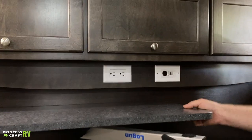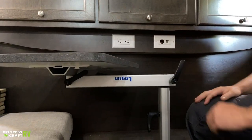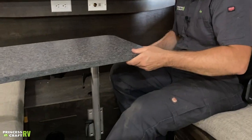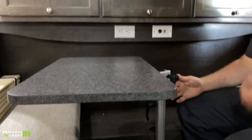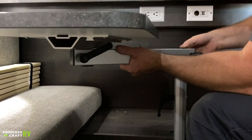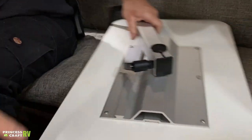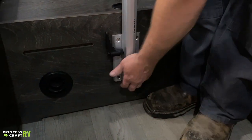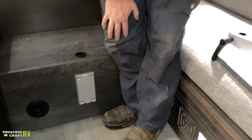We've got your Lagoon table — this thing's pretty cool. It can be moved around and does have all these lock levers to keep things stationary. This table can swing around and be used pretty much anywhere you might want it, and it can also be moved to the outside of the trailer to the mount out there. To get this off, personally I like to take the top of the table off first — just loosen this up and pull up to remove the table top. Then to get your post off, loosen the very bottom one — you can see this is also adjustable for height. Once you get it loose, it just pulls off.